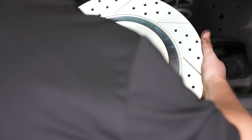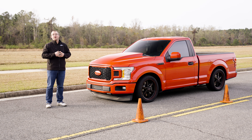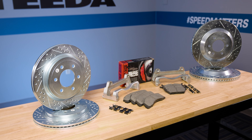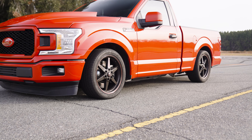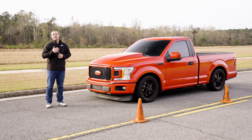Installation is just that — pads and rotors. The only difference is you're adding that caliper bracket up front. A huge benefit over many other brake upgrade kits is that it doesn't use an adapter, which could be sketchy if not manufactured or installed correctly. Bear cuts that out by including a brand new caliper bracket with the proper offset so you can use that enlarged rotor up front. Everything you need for an easy installation is included, and it takes basic hand tools to get it done at home, even if you have the electric parking brake like this F-150. Be sure to comment below and let us know what you think of these results. If you want to see any other F-150 or Bear Brake videos, we are all ears. Be sure to hit that like, subscribe, the notification bell, and don't forget the most important thing — speed matters.